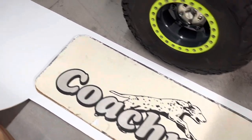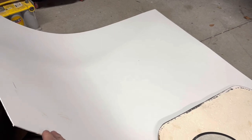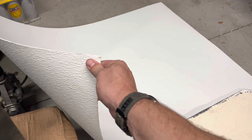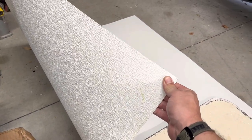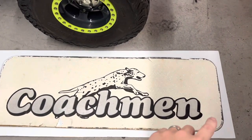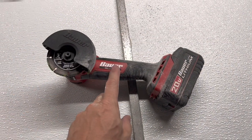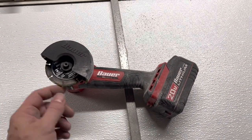Once you've gotten your old one out, go to the hardware store and pick up some shower wall material — a four by eight sheet. The part number is 788594490185, called a glass liner. This is the shower stall material they use for quick installs. The back side — the smooth side — faces outside toward your car. The textured shower wall side faces toward the window, because I'm putting a new decal on top and wanted it nice and smooth. Lay it out, take a permanent marker, trace the old piece on top of the shower wall.